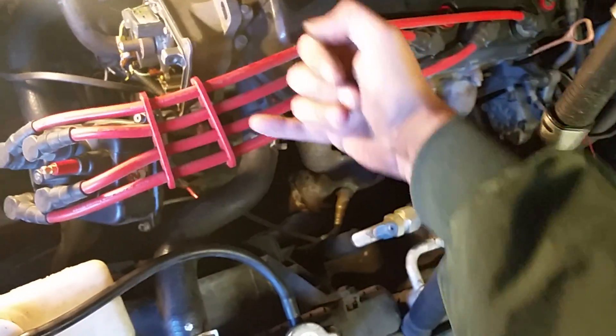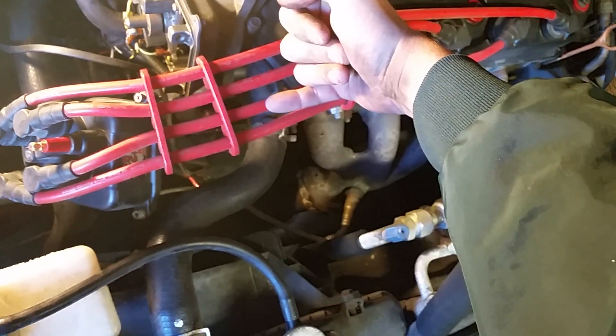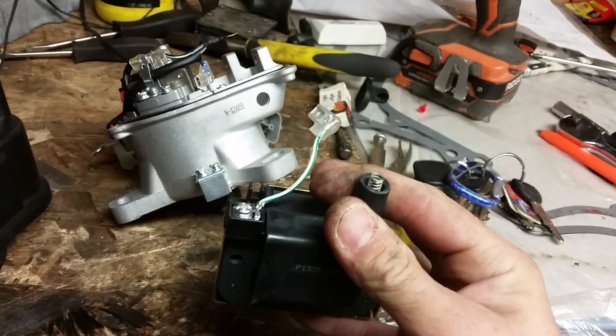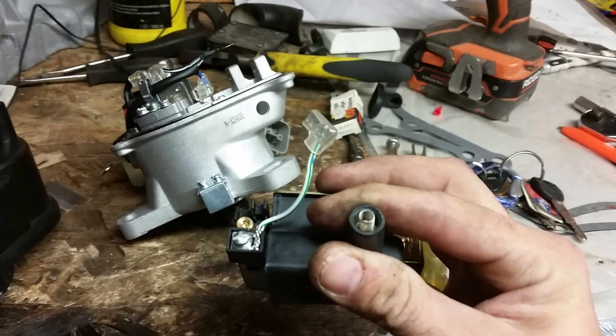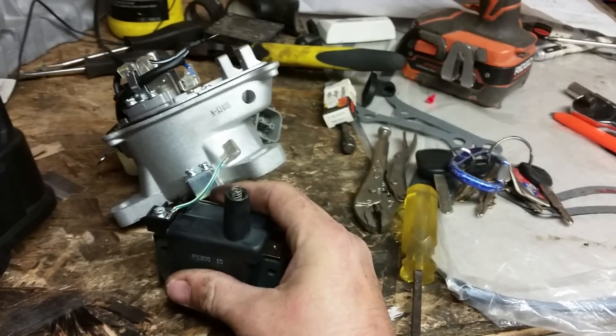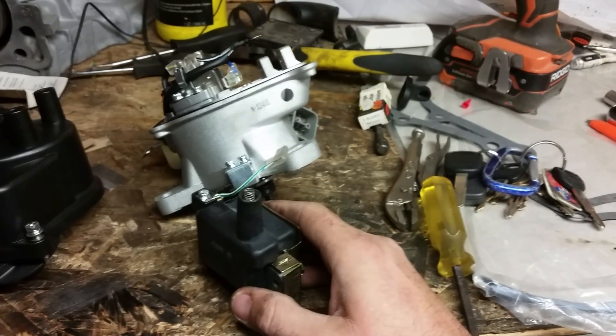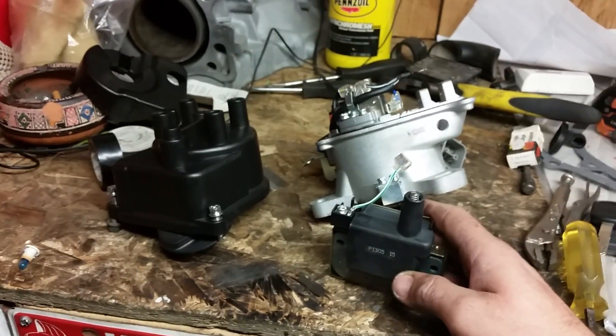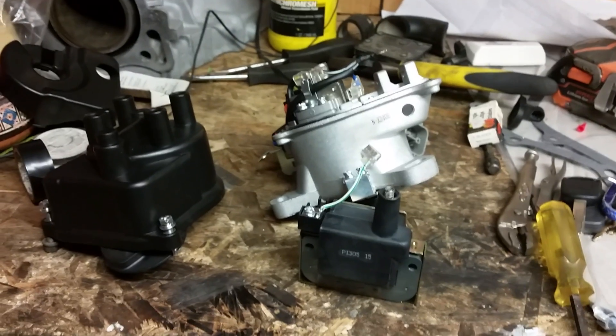They provide the wire to carry your spark; you're on your own for spark plug wires. Mine are pretty fat — I run a 10.2 millimeter spark plug wire because I'm putting out a lot of spark. That's how you do the modified cap and rotor and the external coil on a Honda Civic 1.5 or 1.6 — generally any Honda Civic and a lot of the Del Sol and D-series Integras. Thanks, VR Mousy, enjoy.